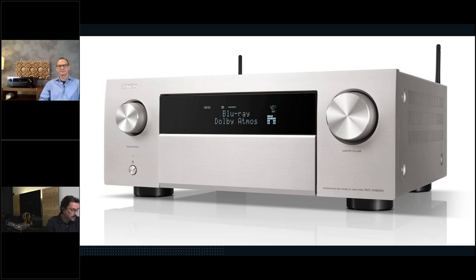The first question is about HDMI diagnostics: which of our AVRs have it, and are we planning to bring it to all AVRs? Yes, it's already available on all AVRs — not just limited to the flagships, but across the whole lineup. For those with access to D-Media, our platform for service and user manuals, you can also find the HDMI diagnostic user manual there. Just search for 'diagnostic' and you'll see HDMI diagnostic in the results — pick from different years as the button combination to activate it changes slightly.